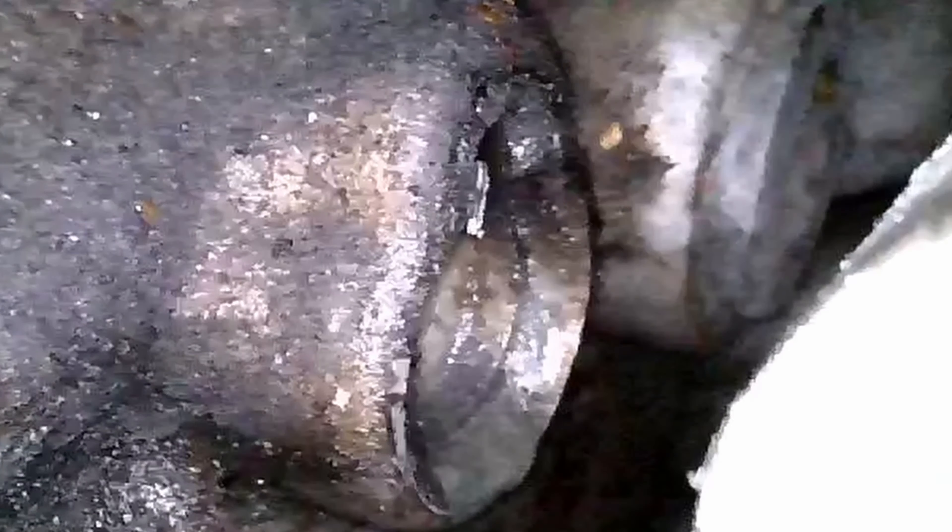So we got our serpentine belt tensioner removed. Pretty hard to get in there with a GoPro and check this. So we're using a bore scope here, getting you in close to this core plug. Just above it you'll see the weep hole drain. That little hole right there. Again, this is very hard to see in the vehicle. I tried getting a mirror on it and checking it, but it's tough to even get a light situated in there and get a mirror on it.